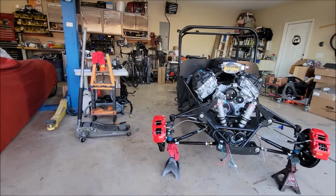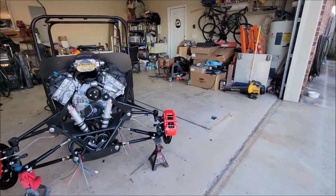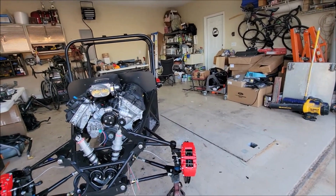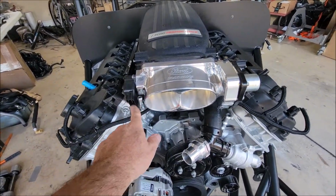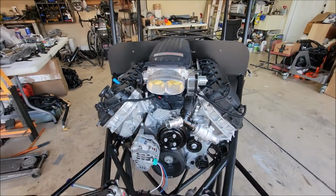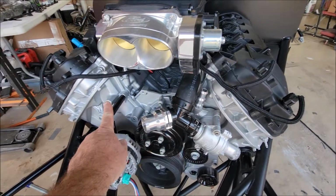Yeah, I think tomorrow morning, while it's fresh, I'll probably run around and, before it gets too far more into the truck, I'm going to torque all the suspension bolts and get a little bit better alignment on the front. I've got this drunken camber, that's definitely not the camber we want. So I'll get that all figured out and get the alternator. That's it. And I'm still waiting on the little harness that goes from here and here down to the stock spot, and then I've just got to get a small piece of 5/8 heater hose to go from there to the other one.